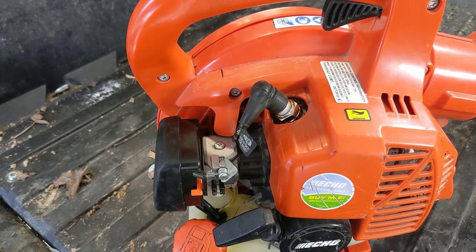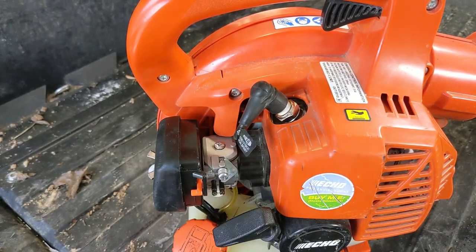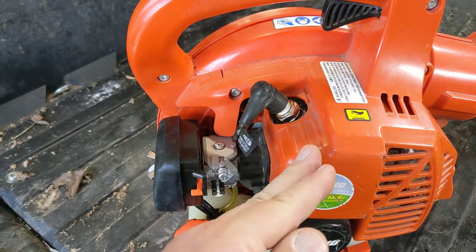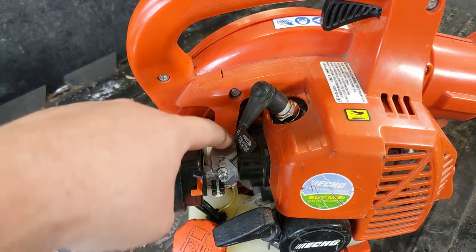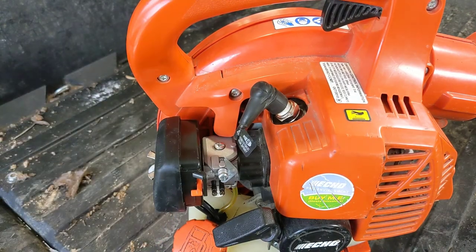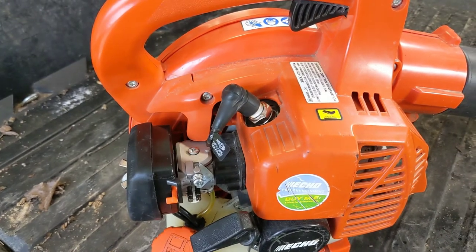So it's tuned again. It's pretty good. I got about a quarter turn on the idle adjust. It's not quite right. My point is, I don't honestly know if I did anything with cutting that hole, if that's supposed to be there. But seeing as how the engine side had it, and the carb had it, and it does feed to where the fuel is in the carb, it leads me to believe that, yeah, it was supposed to have been there. However, it's an old carb. Although the diaphragm seemed clean and flexible, it still doesn't seem to run quite right.